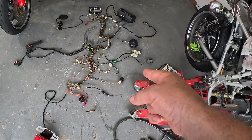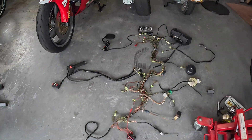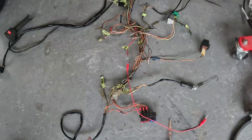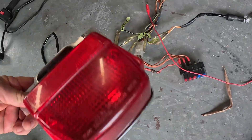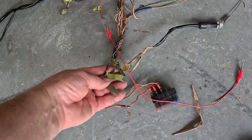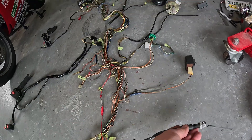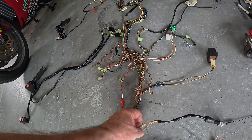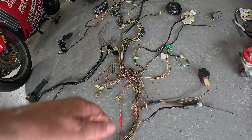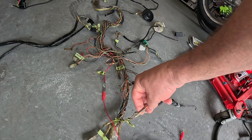Now that we've gotten rid of the rectifier regulator, the stator, the coils, and the CDI or points, it's just a matter of going through and seeing what you want and don't want. Tail light and rear blinkers — we obviously want those. I may not use this tail light but I definitely want those connections, so I mark them all. Now I've got outlets I can plug my new stuff into. There'll be a brake light — one from the brake pedal, another up front for the handlebar. We definitely want the brake light — those are handy and already wired.